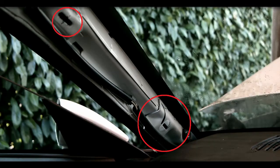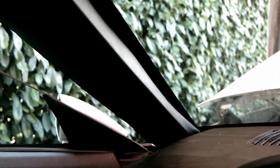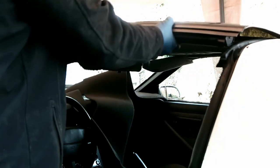There are two notches on the A-pillar in which the clips go into. Go ahead and reinstall the interior trim piece, and finally screw in the final screw. Reinstall the t-top and close the door.